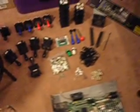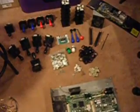But that was all that I got that came with the monitor that I'm going to put in the cabinet, the Mortal Kombat cabinet right here. I'm going to take this sucker out. This is the crappy tube I got from that local operator, and it's not worth a darn. Chassis on it is still in great condition. It's a K7100, I believe, 7100 series, and I've recapped it and everything, and I think the chassis is in excellent condition. I just don't have a good tube to put with it.